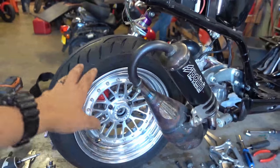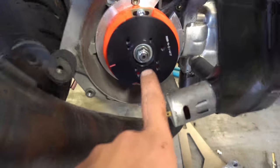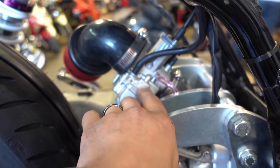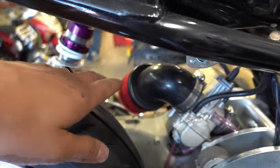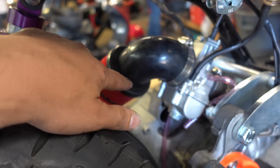So, Bruce Chapman's pre-bug — you guys know it has a big Evo 94. You've got the MBT ignition fitted up here. We had to flip around the intake manifold. We had the MXS, and now we have the Stage 6 intake on here to clear. Went down to a Polini 30 because this intake design does not allow for a 35 that was on it before, so he gets a new carb. This filter is Stage 6 — we sell these specifically for Zumas that have these 90s on them because you can't buy them that way.